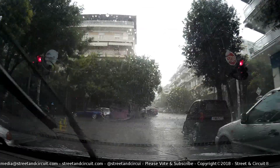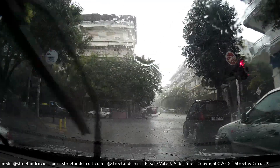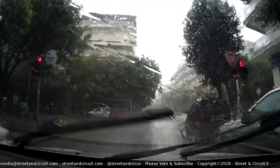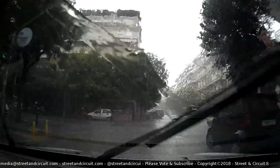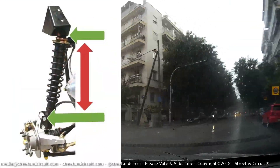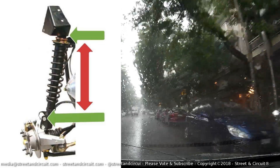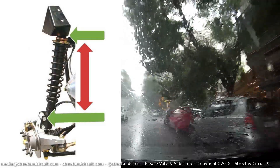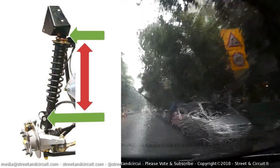The car's factory suspension with the factory springs — it's going to be next to impossible to get that right first time at least. So I would recommend you measure the distance between your top mount and the bottom mount of the damper with your car's factory suspension. Work out where that is, that distance.